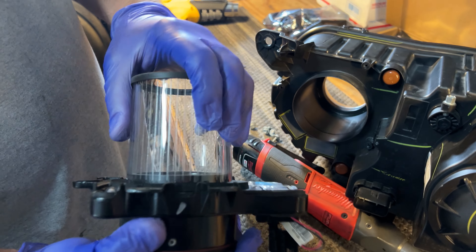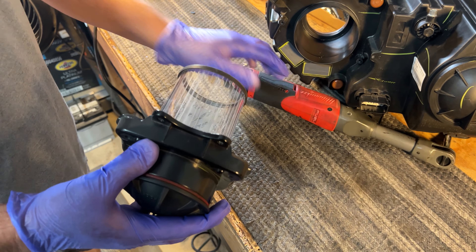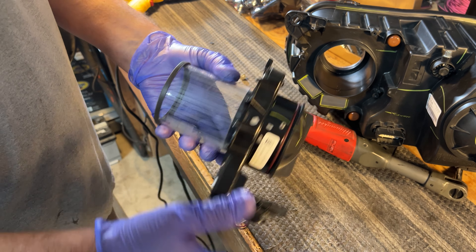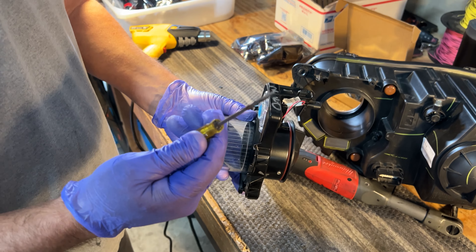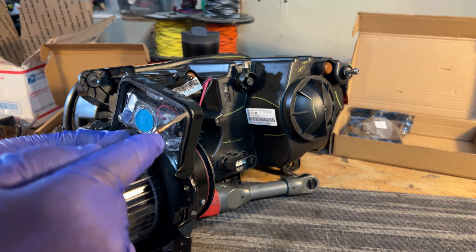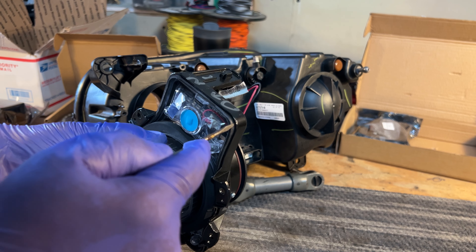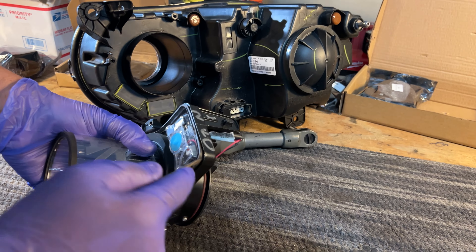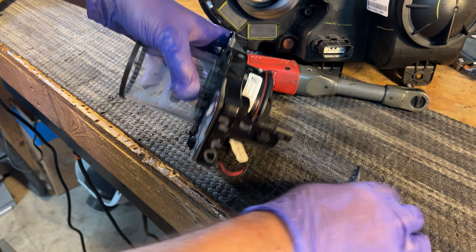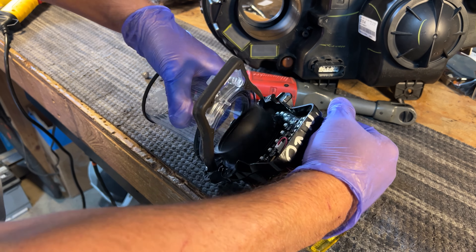This is tight — it's friction fit, but it's tight, and this is the problem. On the passenger side, to get this around the ABS controller, you need to separate the clear acrylic from the back plate, and that's simply achieved by taking a small flathead screwdriver. You insert it in the curved part between the seal and the metal — not between the acrylic and the seal, but between the metal back plate and the seal — you push it in and you just pry it up a little bit. Pry it up again, and that gets it started, and sometimes they're a little bit temperamental, but then you can see that it comes right apart.